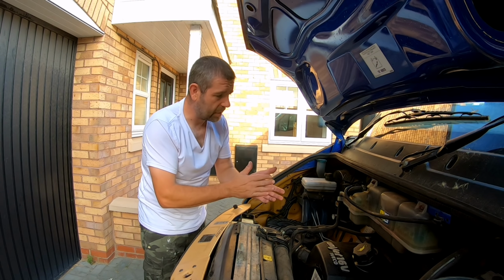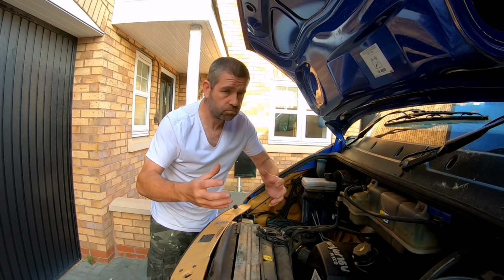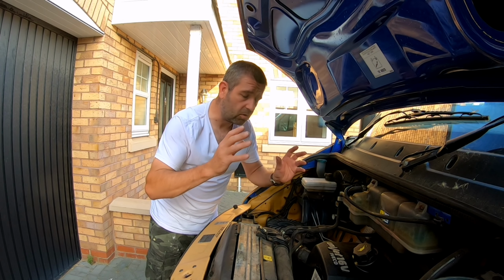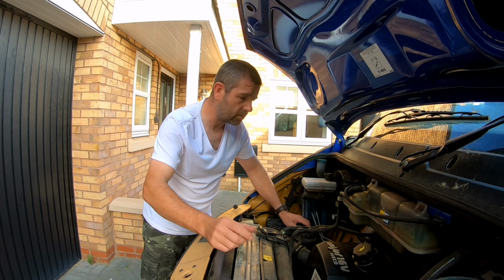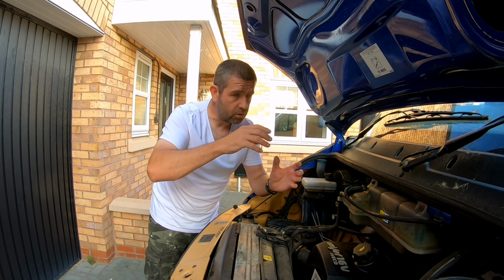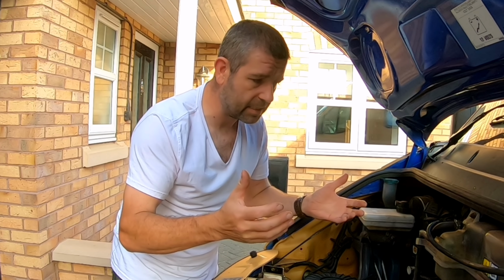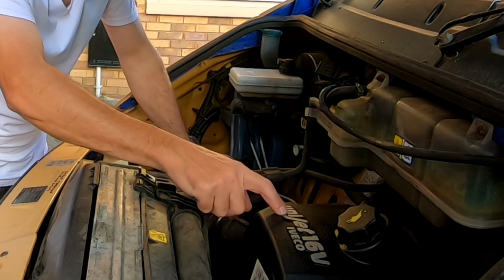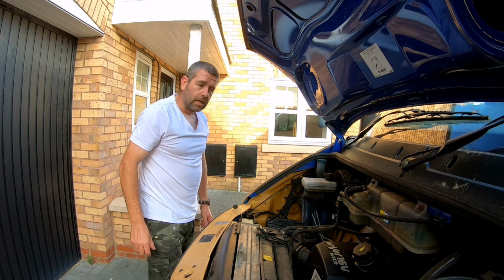Now, it could be oil just builds up in the back box itself, that's what's leaking and smoking. But I haven't lost a lot of oil, and I've had that back box off before and it was pretty much empty of oil. There wasn't a lot in there. It is leaking from the downpipe to the back box joining, but I can't see I've lost around about 5 litres of engine oil in that back box, because I've just checked my engine oil and it's okay. So let's release that exhaust downpipe and run it up again.